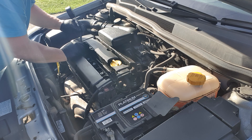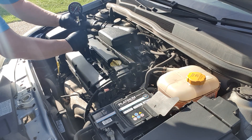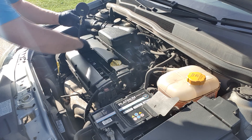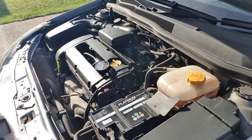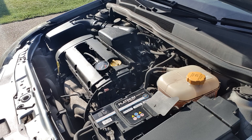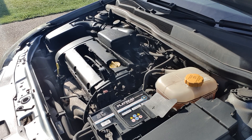If you want more details on the compression tester I can do that in a separate video — just leave a comment down below. Basically it just screws in. There's a little button on the side that you press to release the pressure, so you need to remember to do that every time you take a test. We need to crank the engine over now for between 10 and 15 seconds, maybe up to 20. I'd like to point out that I have removed the fuel pump fuse, because we don't want to be pumping neat fuel down into the cylinders and washing all the oil away. So we'll give that a crank over.